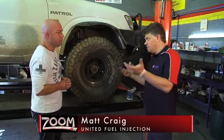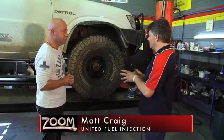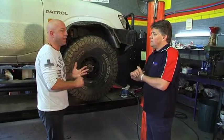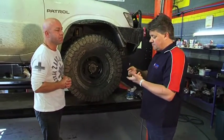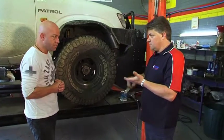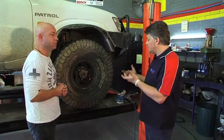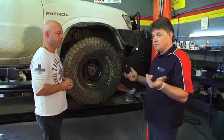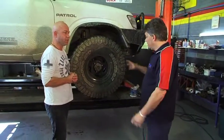A lot of people rotate the wheels or whatever it might be, and checking the brakes is just a simple step after that. Now what kind of tools would we actually need to do it? Normally with your car you've got your jack, your wheel brace, wheel chocks, all that sort of thing. So you jack your car up, put an axle stand under it, chock the wheels, remove your wheel as per you would any other time and it's all there, ready to go.